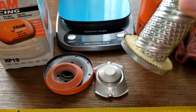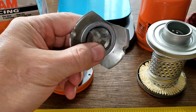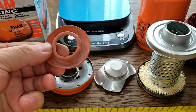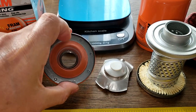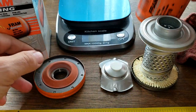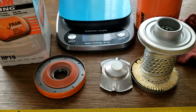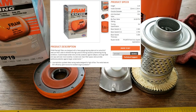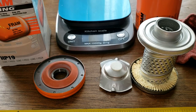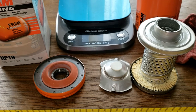Let's look at the rest of the filter: metal core with louvers, end caps — nice. Bypass valve is nice, with the screen — something different. Silicone anti-drain back valve — these are always nice and it fits on here really well. You've got a nice thick can. Not a bad filter. Filter media is pretty good with a good micron rating. I want to give Fram's website a thumbs up because all the information I got on this filter was on their website. They're not stingy like some other manufacturers where you can't find any information. You can find pretty much all the info you want on Fram's website, which makes it easier for you guys and for me to find all the specs.